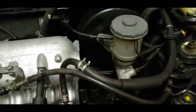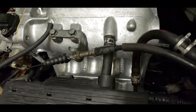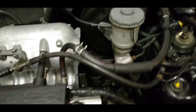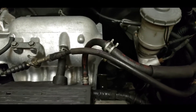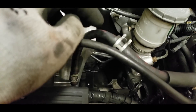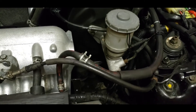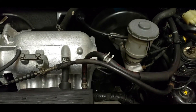Here's another little thing: the fuel return line for the D16Y8 is much smaller than the fuel return line on the D16A6. The little metal pipe is actually bigger on the D16A6 than it is on the D16Y8. One thing you could do is swap the fuel pressure regulator, but then you'll have to replace the O-ring inside and pull all that apart. What I did was take the fuel line for the D16Y8, squeezed it into the D16A6 fuel return line, and used one of these little clamps to clamp it down.